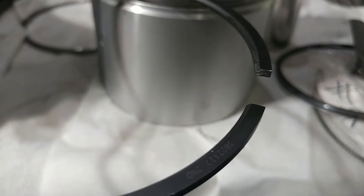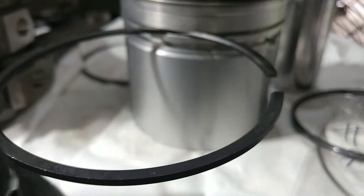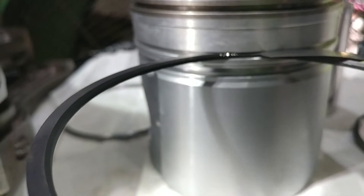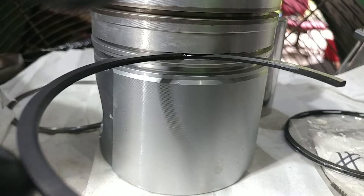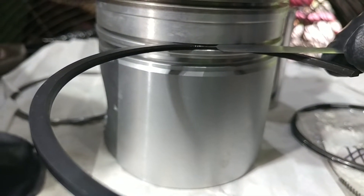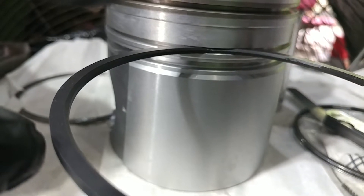We've already gapped all of these — you can see the marks on the end gap where it's been beveled. Now we're putting these in and going to check them across several points. You can see that's a four-thousandths feeler gauge — it just starts to go in there. I've checked all these already, and it just barely starts to go in and then gets tight, so we're less than four thousandths, which is good. The max on these is around four to six thousandths.